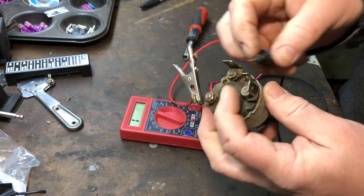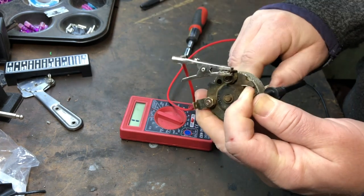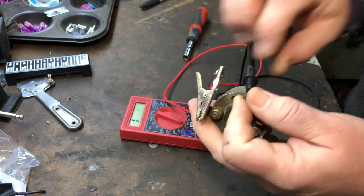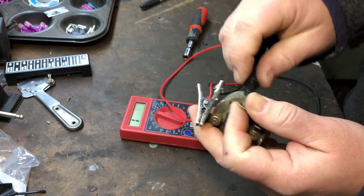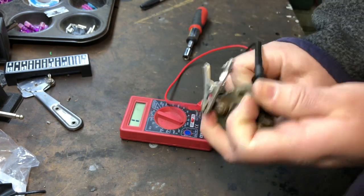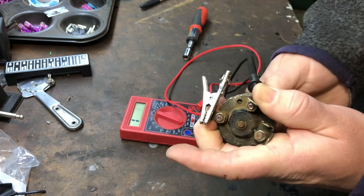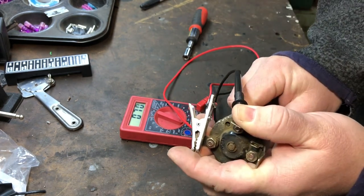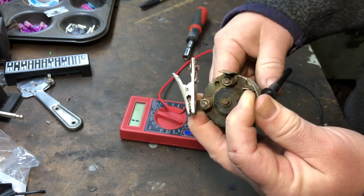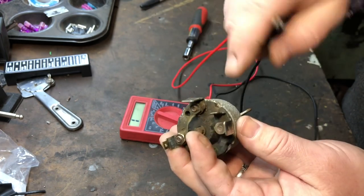Testing with the multimeter — nothing on this one. It's the glow plug position, I'm just hitting that one. Doesn't look like the glow plug one works. We got every variety going around. So let's see the starter one. The glow plug part must be broken. There we go — these two talk to each other whenever I go to the start position, but not at the glow plug. So here I go further and there it jumps. These two are the starter ones and that doesn't do anything at all. So it's looking like I got this one and this one as the starter.